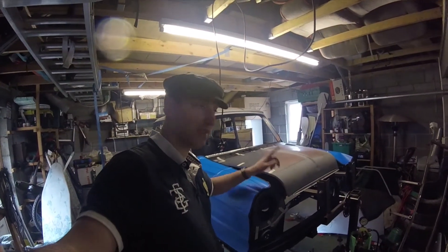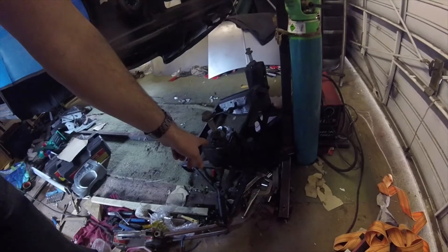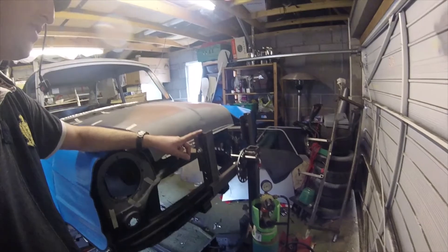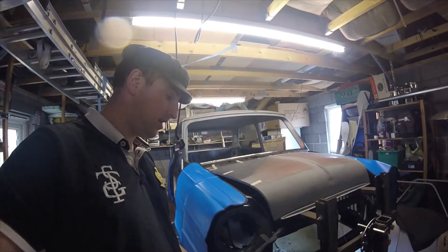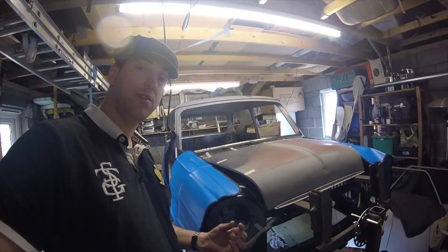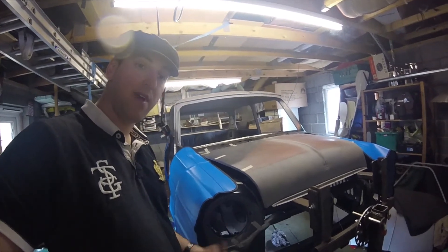Skipped a little bit, but basically what you've missed is the removal of the front subframe and then the reinstallation of the front part of the jig. The reason I've done that is so we can now get inside between the inner wing and the front panel just to make the spot welds there. You shouldn't do it with the front subframe fitted.